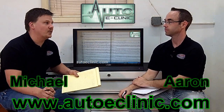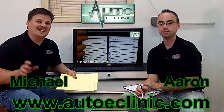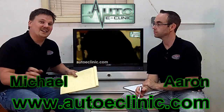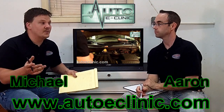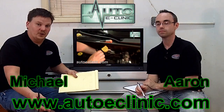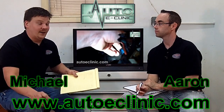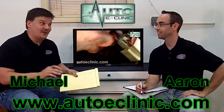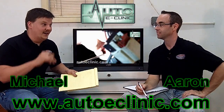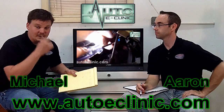We ran into a pretty big issue with wrong color coding and terminal identification when we looked it up. This is an '03 but it's VINed as an '03 — it says '02 on the door. We could not find the proper terminal identification in our computer using two different programs. We went to '04, couldn't find it. Then went to '05 and finally found the proper terminal identification for the PCM. The color coding was even wrong — it didn't look like what it said at all. We used a lot of deductive reasoning to find the ignition one and ignition two primary circuits, but we did find them.